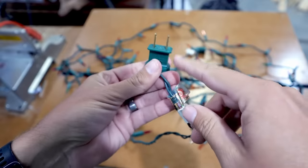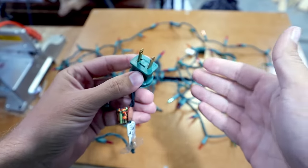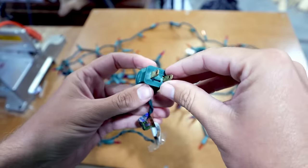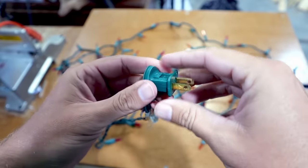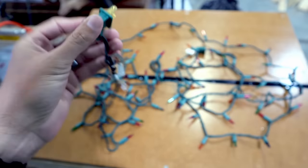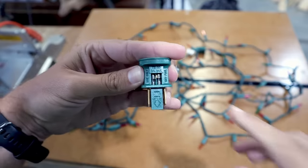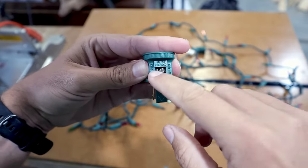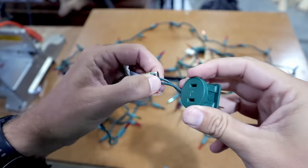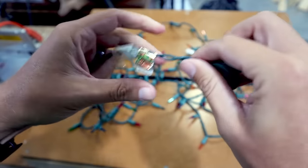You've got your plug, but you've got these two prongs here and they are not polarized. Whereas most of your plugs that you put in outlets, one is larger — which is usually the neutral — and then your line or hot side, that prong is usually smaller. With these Christmas lights, most of them you can put into the outlet upside down and it does not matter which way you put them in, they'll still light up. That's why when we open up this fuse compartment, there's two fuses, one for each side. So depending on which way it is put into the plug, one side is going to be hot and one side is going to be neutral.